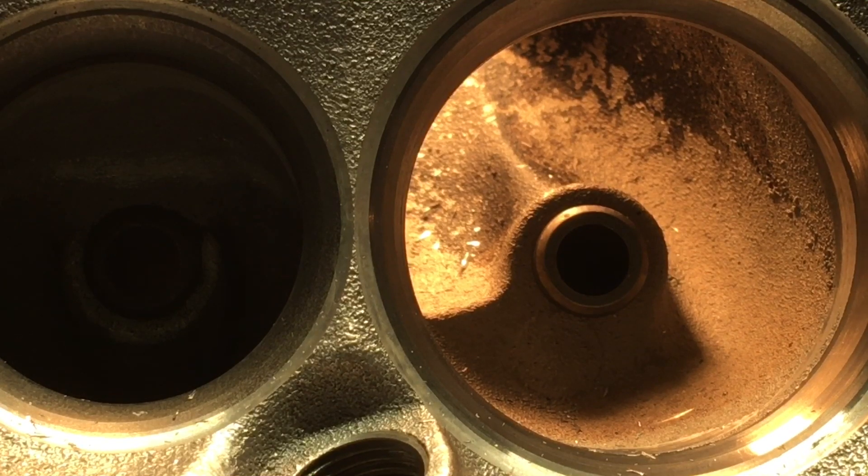So just to give you guys an idea — let's assume we've already done our bowl cut percentage, because I had this valve job done with a CNC machine, so my bowl cut, other than my finishing texture and all that, has been done. Now I'm moving down into the port and I'm going to start doing my valve guide shaping or reduction and swirl, setting my landmarks for my swirl ramp removal.